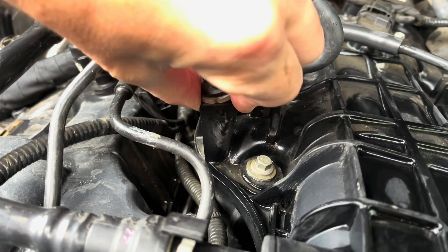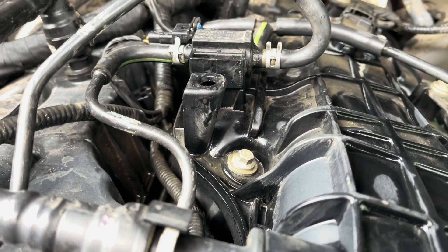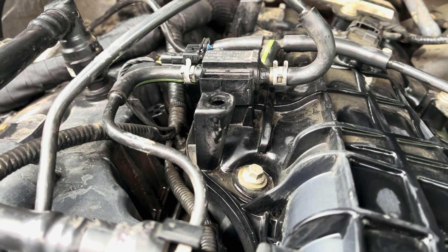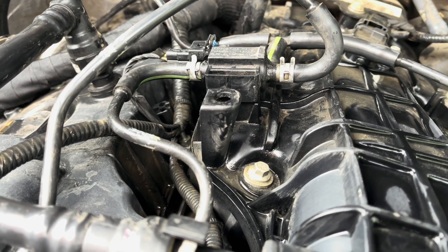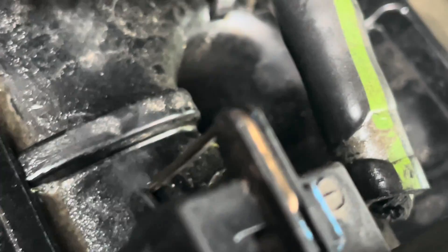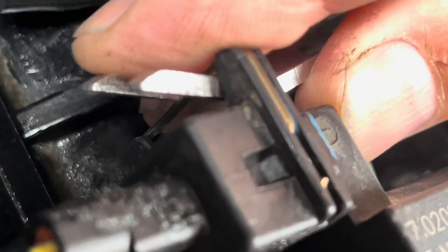This has got a little pop tab that holds it so it doesn't come loose from your intake. Now, the purpose of this thing is when you're under high load or acceleration and then suddenly you release the acceleration, you've got low flow but high pressure inside the system, and that has to basically initiate a blow-off or release of that pressure. If this nipple is constantly broken, and therefore allowing pressure to come out constantly, then you could have a P0299.